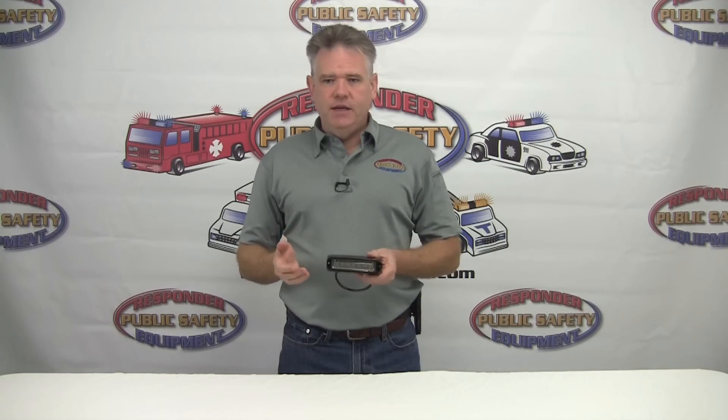This little grille light is one of the newest products available from SoundOff with the Enforce technology. This is a tricolor light, which means that it has all three primary warning colors built in — red, white, and blue. What's unique about this light is the fact that it's not a split-color light where it flashes side to side, but instead the entire light changes colors. There are 18 high-power LEDs inside this unit, six for each color. The LEDs are spread out across the long axis of the light and dispersed with a unique prism and reflector technology that is proprietary to SoundOff.